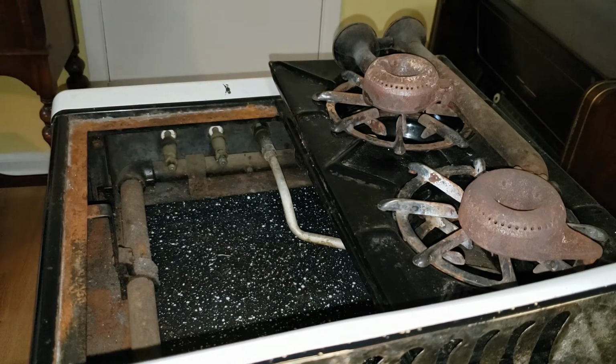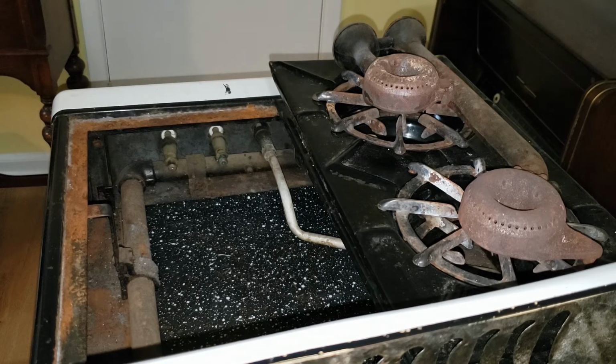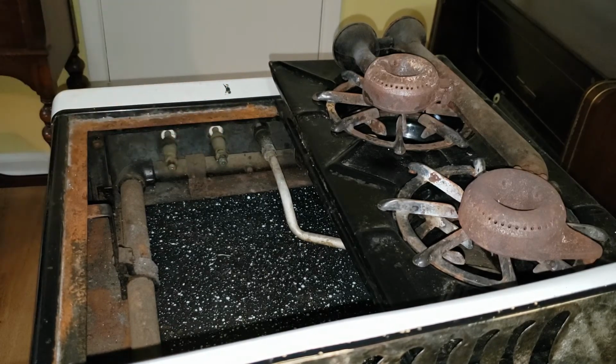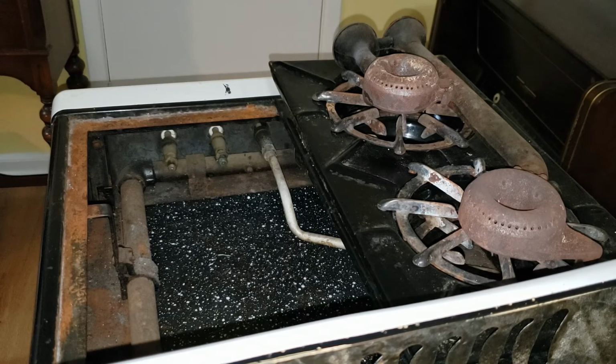These are orifice caps. Basically what happens is you turn the handle on your stove, the valve opens up, fuel flows out through that into the burner where it meets your pilot or your match, and you've got flame, and now you're cooking. So it is the tip of these that's going to tell us what this stove is set up for. And it stands to reason that unless someone's playing a practical joke on you, these are going to be the same on every burner. But on a stove like this, it obviously takes 2 minutes to investigate.